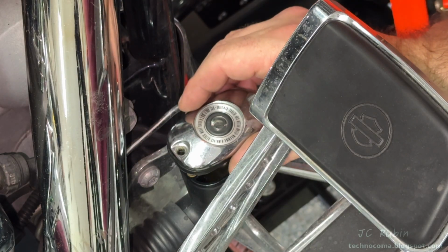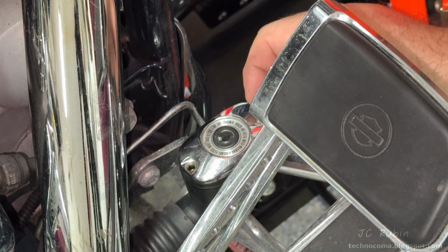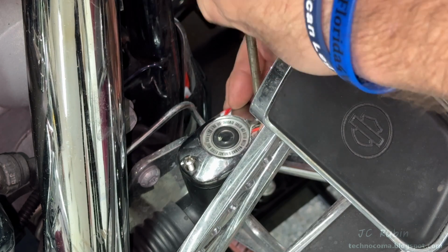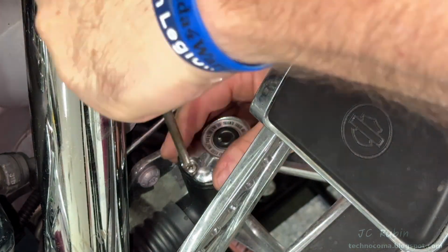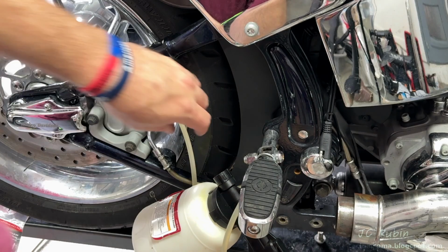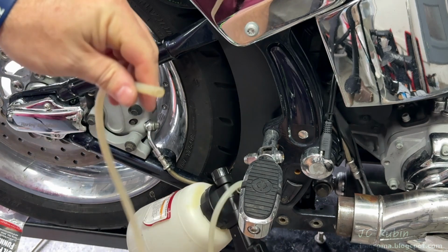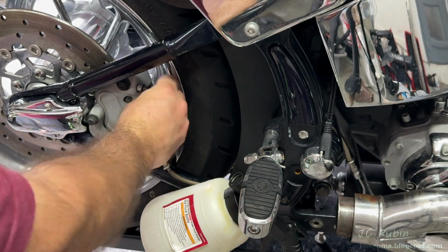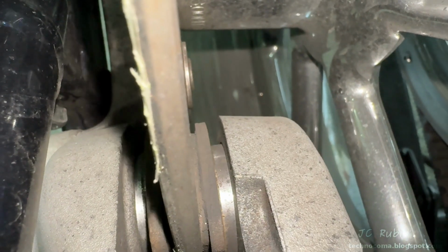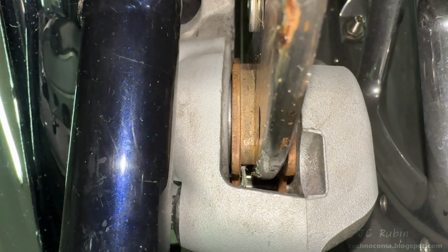Take the cap and gasket, which I've cleaned, and place it back on the reservoir. 2 screws go back in, and those are just snugged back down because it's a rubber gasket. I'll take off the bleeder with the vacuum running to pull back any residual fluid into the bottle. Clean up the bleeder, and pop the dust cap on. Looking back to part 1, this is what we started with. Rear brakes are looking absolutely perfect now, and that concludes the work on the rear brakes.